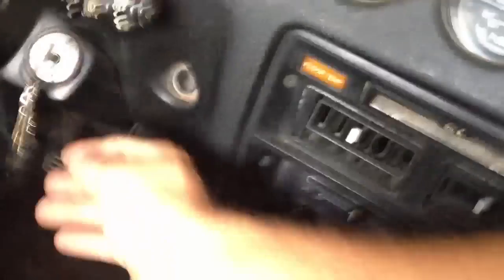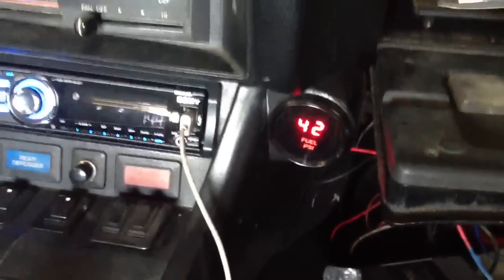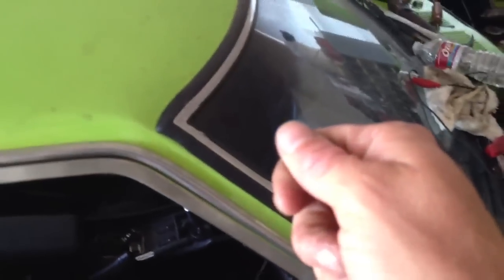So we have connected the power and once again, all I did was switch ECUs. Turn the key off, fuel pump cycles, turns back off. So when the Haltech is plugged in, that fuel pump almost never shuts off. If I cycle the key and try to start the car with the Haltech, it almost will start acting right fuel pump wise. But once I turn it off, the fuel pump comes right back on again. So that is my issue I'm having.